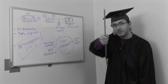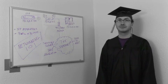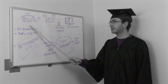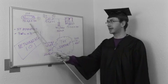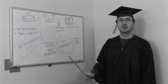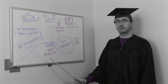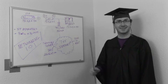Does that make sense to you, ignorant user Pox? Hell no. I just want to listen to music on my PSP — how do I set up the connection? First off, you just need to set up the WiFi connection between your PSP and your WiFi access point. You can set it up to be DHCP and you'll get the address automatically from the access point. The latest version of PSP Radio supports DHCP so we can get that address from the access point. From there you simply get a Shoutcast server IP address that you want to use — those are readily available on the Shoutcast website.